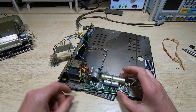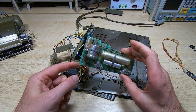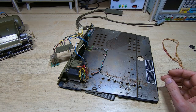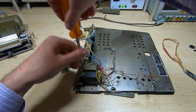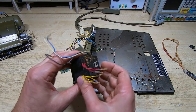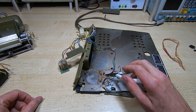Next I'll get the power supply removed. It looks to be in good condition. We'll need to check the condition of these capacitors very carefully — they don't look too bad, but it probably hasn't been powered up for a very long time, so we'll come back to that in a future video. The next thing is to remove the mains transformer. I'll test that separately before refitting it. If these need rewinding they're a pain because it's a split bobbin, not a single winding, but hopefully that will be okay. Most of the muck and debris in here is from what's left of the belt, though it also looks like we have remnants of some wildlife in there.